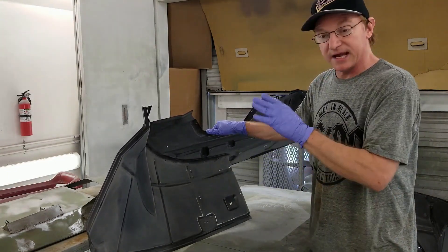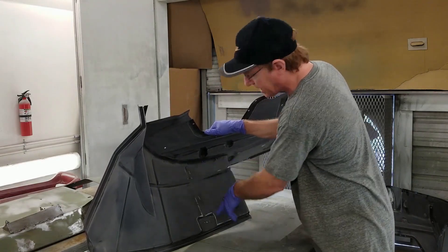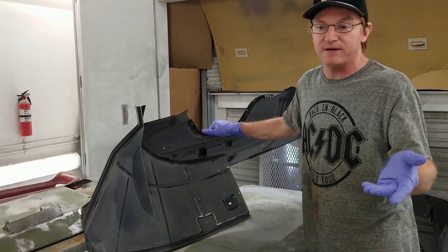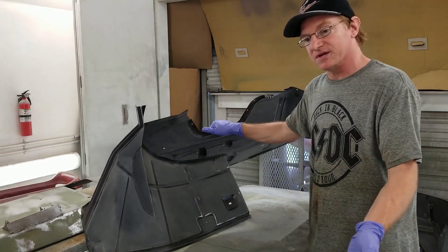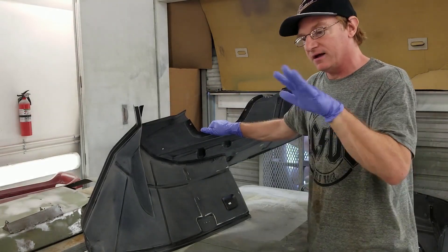It's very important this gets scuffed. It's okay if you punch through — if you see a little style line breakthrough, that's normal. It happens on any vehicle we're working on. Even when we go to sealer, we have style line breakthrough on the final primer — that's normal. Sealer coats are good for that, as long as it doesn't ring through. Ringing means it shows a halo effect on top of the coating.